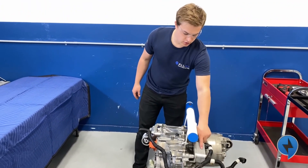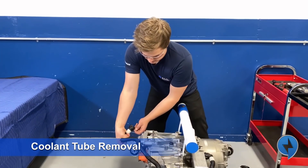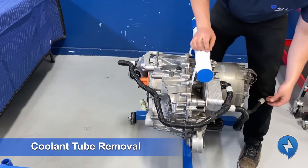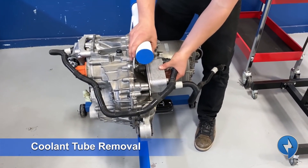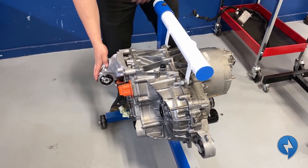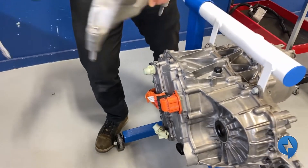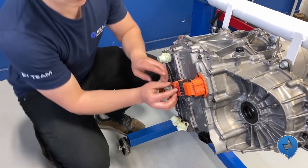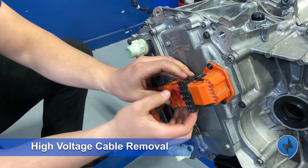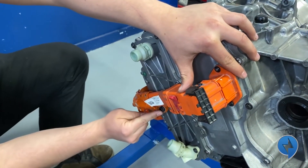The first parts we have to remove — there's a little clip; once you pry that with a screwdriver you can pop it off. There are a couple of clips and then two bolts. Next up we're going to remove the front left motor mount. Next up we're going to remove the high voltage cabling. The way to remove these large connectors is you have to pop the red little snap and then this whole arm goes up and releases the latch — that'll pop this off. We've got a 10 millimeter bolt here; we're going to remove that.